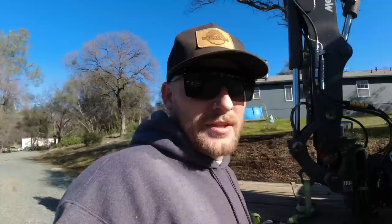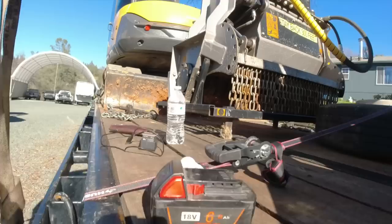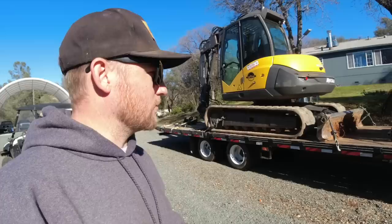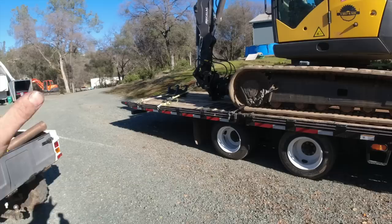So I'm going to go ahead and strap down a couple more things, just show you how I roll with it. I got a little more tie-down to do on this side right here - a little collection. I like these little white ones, they don't work good for anything else besides this kind of a trailer. I do want to point out that I've been using those speed binders and that drill gun for the last four years. Those things have been with this trailer since it was brand new - I got it in 2019 - and they have not had any issues whatsoever. They've worked great the whole time. They've got a little grease zerk on it so you can lube them up. If they sit out in the weather for a little while, I usually just spray a little bit of grease right in there - just a spray can kind - to give her a little lubrication.